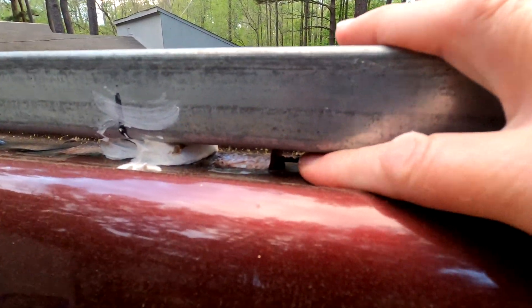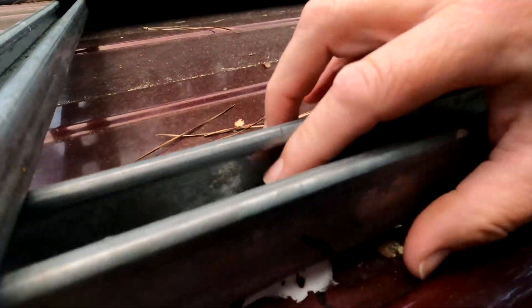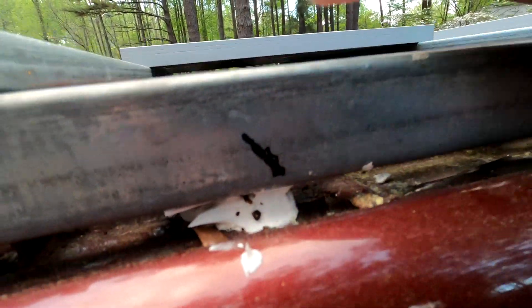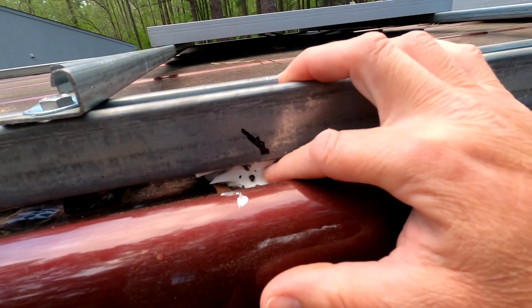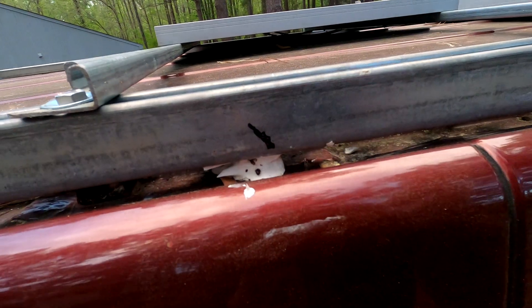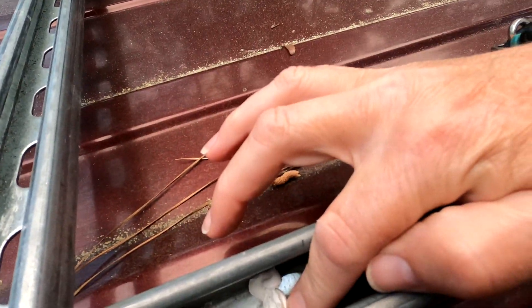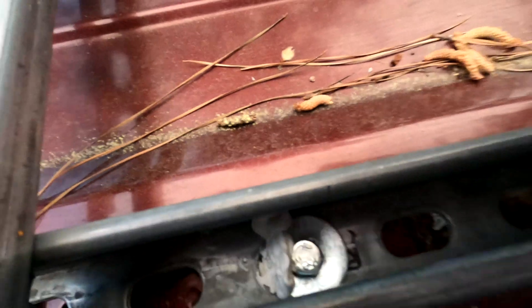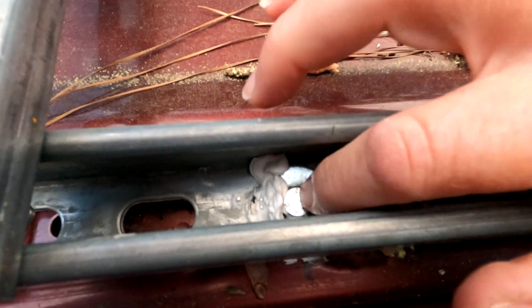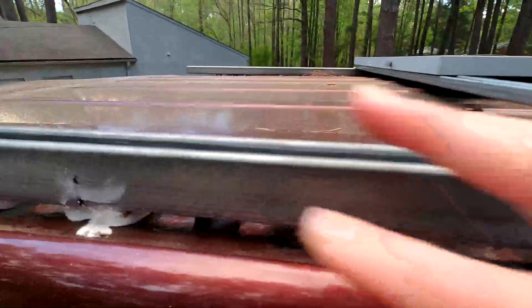We have a tip for you. The brackets here are so small that you can't work with your fingers or anything to hold the nut in place. Take the washer off, take the screw, fish the nut down in there and then lightly get it started. Then pack under the bracket really hard with a napkin or paper stuffed in there with a screwdriver — that holds the nut right where it's supposed to be. Then unscrew the screw, put the washer on, slide it in there and tighten it down. The napkin actually held the nut in place until we could get it tightly screwed down.